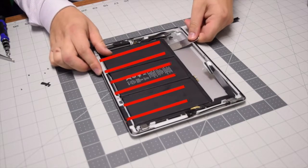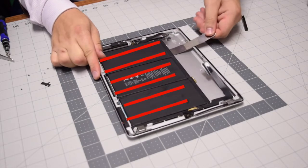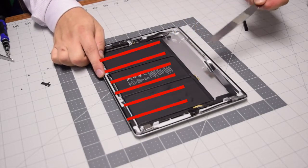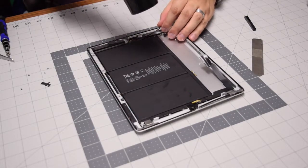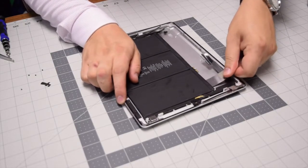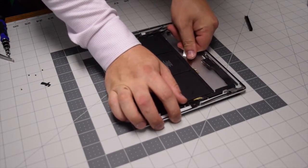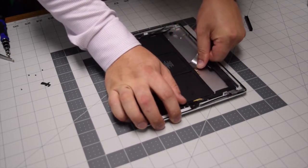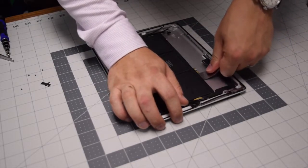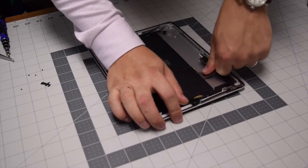The battery is glued in with six double-sided pieces of tape underneath each cell — two in the following orientations. With your thin pry tool, start breaking the seal on the double-sided tape. Heat up the battery slightly — don't heat it too much as it could be dangerous — then start prying. This is tedious work; be very careful not to rip into the battery. If you pry into a battery with a metallic tool there's a good chance it can catch fire, so go underneath and never burst the battery with the tool.